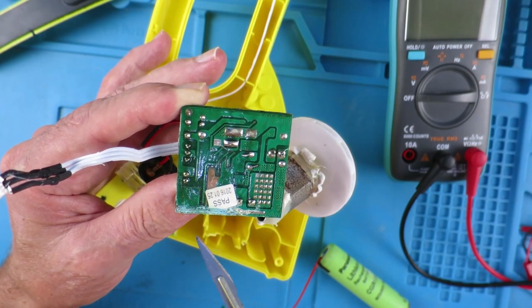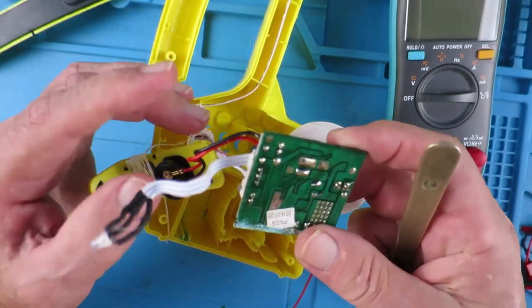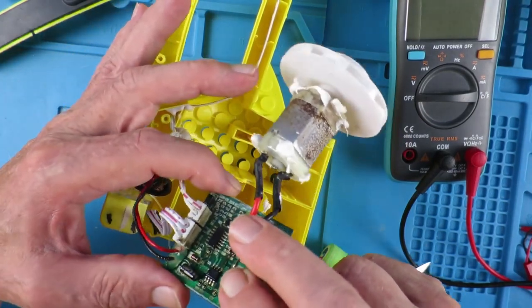When we turn to the back of the board, it is heavily corroded, and in fact some of the enamel is coming off as well. We'll need to get that cleaned up and take a closer look. Perhaps this is also the reason why it won't switch off - we'll have to look at these connections and see if they're corroded too.